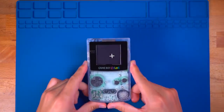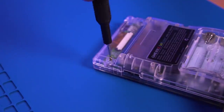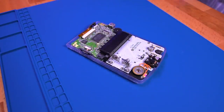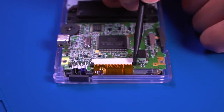Now that we've seen all the parts, let's start building this Game Boy Color. Getting right into it, first remove all six Tri-Wing screws. With the console open, proceed to remove the three Phillips screws securing the motherboard. Delatch the LCD ribbon cable, and then remove the motherboard.